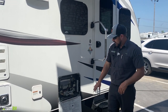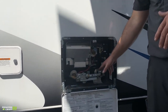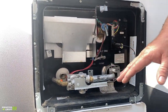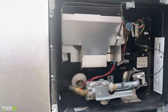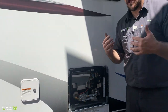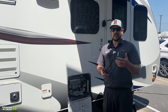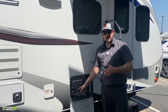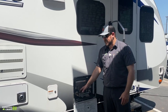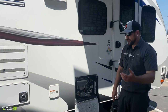That brings us to our gas-electric six-gallon water heater. Open it up and check for insects that can get into the burn chamber or gas tube. There is a drain plug in that little hole — that's how you drain the water heater. Drain it any time you're not going to be using it for a while, storing it, or winterizing. I recommend keeping a couple of extra drain plugs on hand — they are plastic or Teflon and can cross-thread easily, so it's good to have spares.